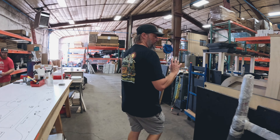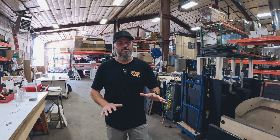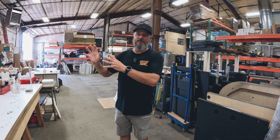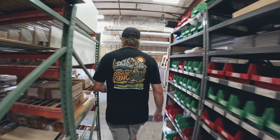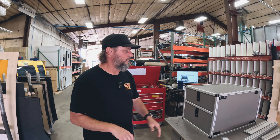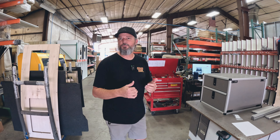These are all plates — customer orders that have gone through the entire cutting, sanding, prep, buildup, coating, and drying process. They're set on carts to cure for a couple of days, and then Kyle combines all the pieces, hardware, and brackets, gets them ready for the shipping crew, who box everything up and ship it to the customer. Modules are built over here — they have cold saws for all the aluminum, automatic and semi-automatic saws to get everything done accurately. This is actually a double drawer module going in the Ineos to create the Ultimate Chef package. Almost everything is built in-house — extrusions, panels, and now drawer boxes are all machined in-house. New stuff is coming for internal storage for drawers. It features metal latches, super heavy-duty drawer guides, aluminum frame, and composite panels — super lightweight but strong and reliable.